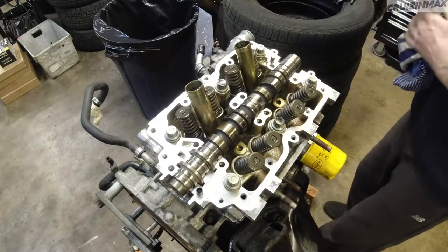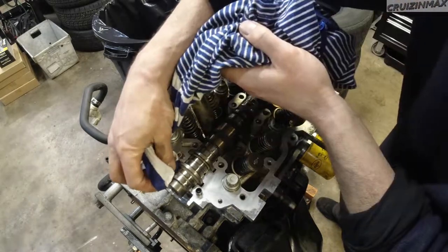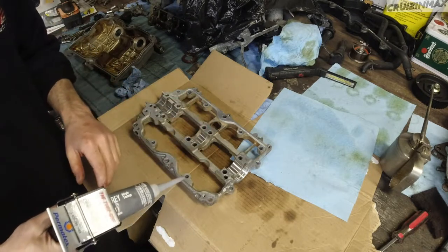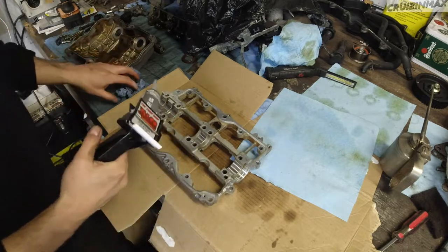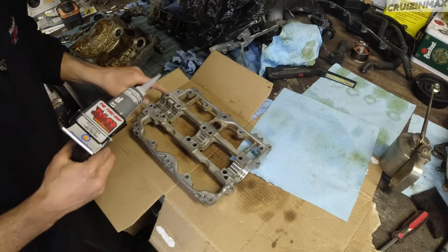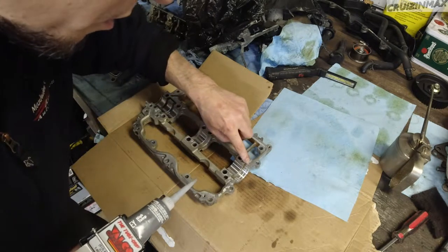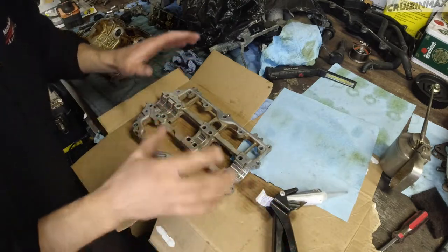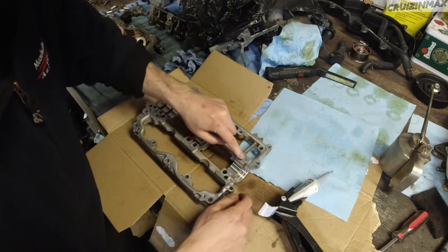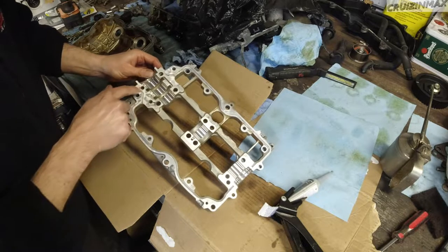You see this here — this is what I didn't want, extra oil here. The inside doesn't really matter, I'm going to be cleaning that again anyway. This is called the cylinder head deck, I think — could be wrong. So I'm going to apply a three millimeter bead of RTV in this groove, but I'm going to continue a tiny bit here. The instructions say just to fill in the groove, but there's also this part here near the oil seal, so I'll show you what I'm going to do.